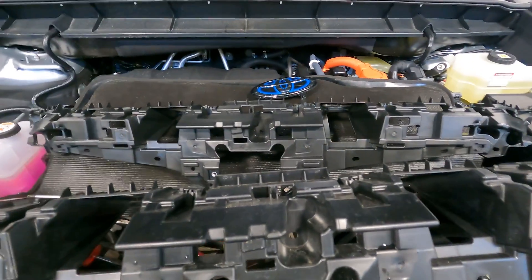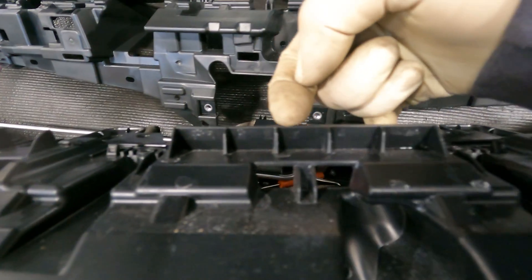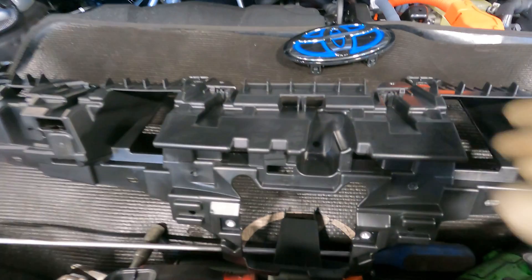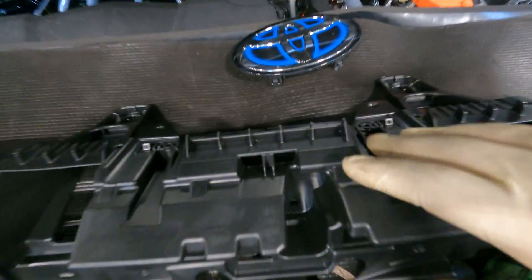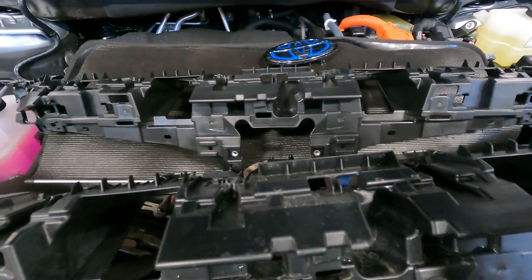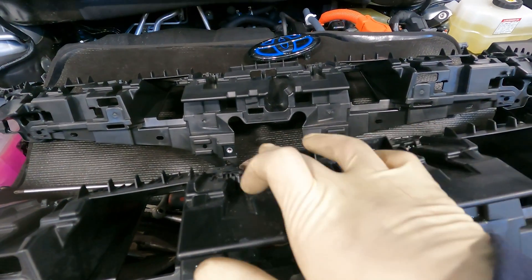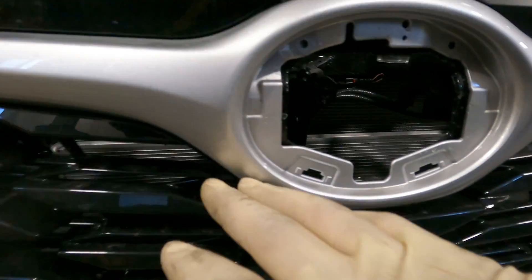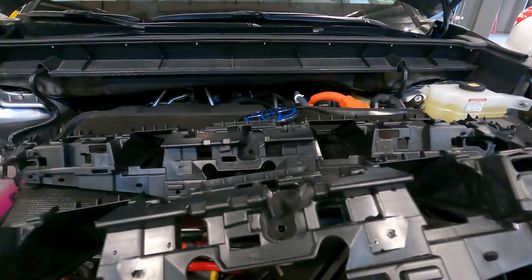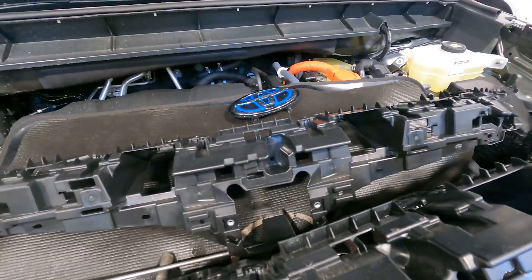Like I said, when I popped the hood the noise went away. You see right here how this wall on the old piece goes all the way up these ribs? Well, on the new one, that wall only goes about halfway up. That's probably why they have a redesign on this piece. If it fixes it, all speculation right now — the wind would pass through the top of this area, through here or even through the grill, and it would make a whistle noise. And when I popped the hood, the noise went away. So yeah, let's get that new piece in.